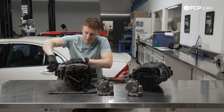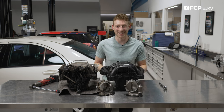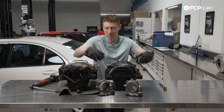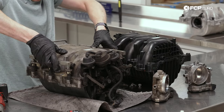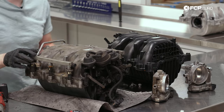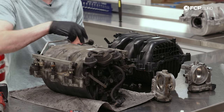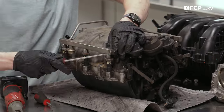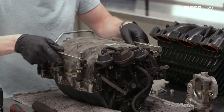I'm going to transfer it directly over. The easiest way to do this — to make sure you don't accidentally do it backwards, which is pretty hard to do with a standard manifold, not so hard with this one since there are no bladders — just line up the throttle bodies and then gently coax it directly up. It may fight you a little depending on how long it's been there. If it is fighting you, you can take a flathead, stick it underneath the bolt holes where the rail bolted to the intake manifold, and just pop it upwards gently. Once it's out of that seated position, you can pull it up by hand.